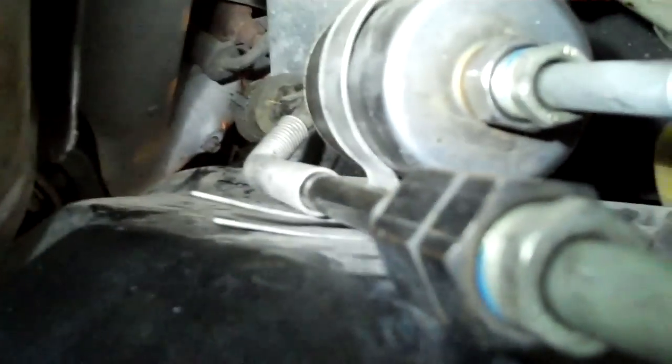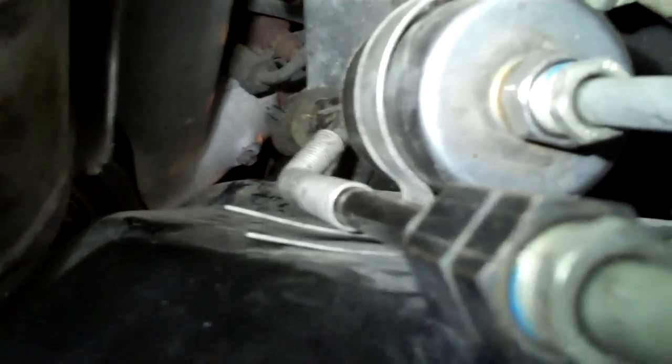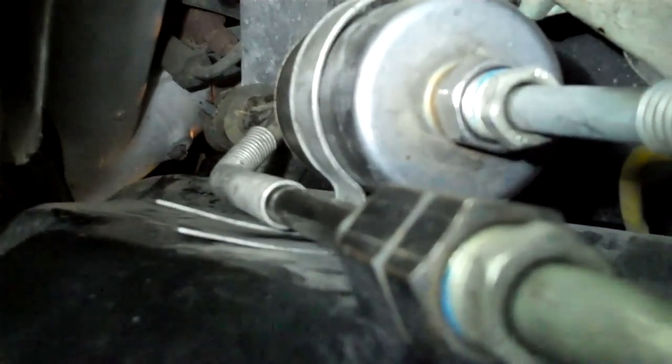You undo those four bolts and then there are four nuts that tie in the middle where it makes an X with the other cross strap. With this pulled down I'm able to get my arm in, otherwise I wouldn't be able to reach the upper fitting. Once we have the fuel filter in place, put the strap in — you can see how the strap goes under the return line. I like to get that tightened down before doing the nut on the bottom. With the little 10mm bolt in the strap, I can reach in and screw the bottom fitting down. The only reason I can reach in there with my hand now is because I have that cross strap undone — I'd recommend just doing that to begin with.